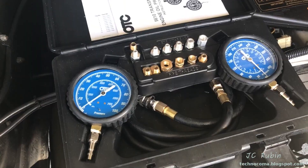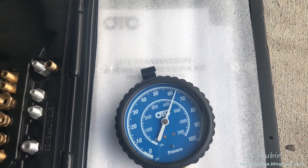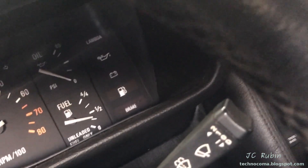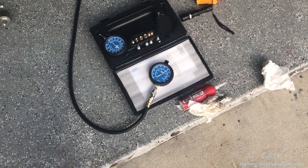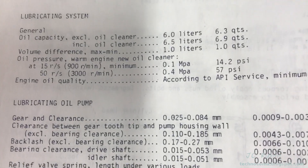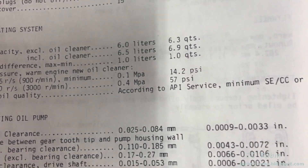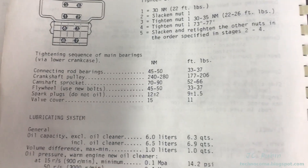Let's get started. This will be a measure of DeLorean oil pressures — this is cold, the engine has just turned on, it's only been running about a minute or two. During this test I've shorted the signal to ground, so the gauge is pointing to zero. I'm waiting on a full fan cycle. The book states that with a warm engine and a new oil filter at 900 RPM you should see 14.2 PSI, and at 3000 RPM you should see around 60 PSI. Oil in use is 10W-40 for this test.